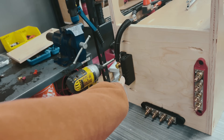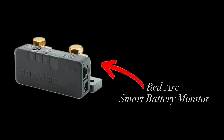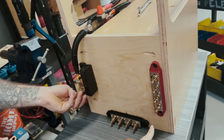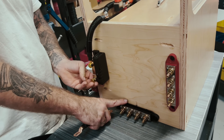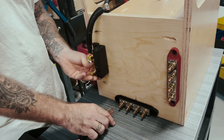That's the shunt — it reads all the power going in and out of your system. It'll tell you how much power you're using and how much power you're receiving. And these are bus bars — this is your negative bus bar, so all your negative loads are attached to this, and then all your positive loads are attached to that.